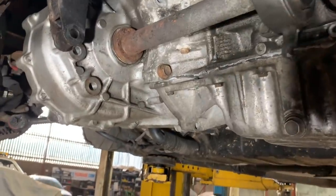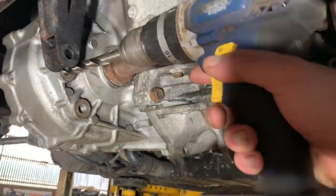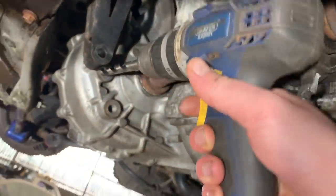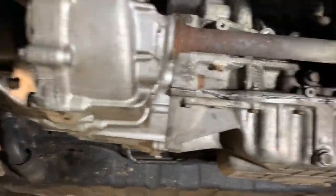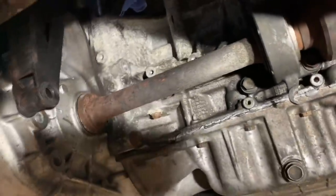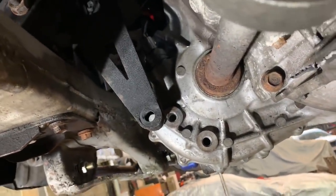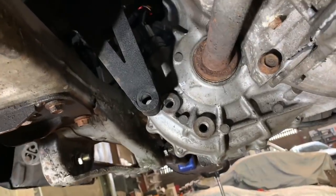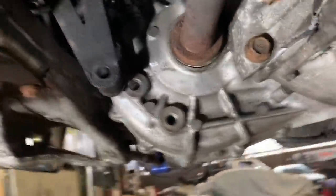I've just hit a slight problem - because the drill bit in the drill is so large, I can't quite get onto the square because of the half shaft bearing. So I'm going to take that off, which means we'll be losing our gearbox oil, so I'd best drain the box oil. That's fine because I've got some new box oil to go in there anyway. You might notice this box crunches a little bit - I'm hoping it's not anything serious, hopefully it's just the cables or the fluid. I've got some Torco fluid to go into it, which is recommended by M-Factory, so hopefully that'll keep the synchros and the diff a bit sweeter.